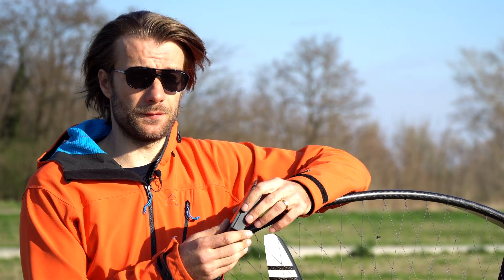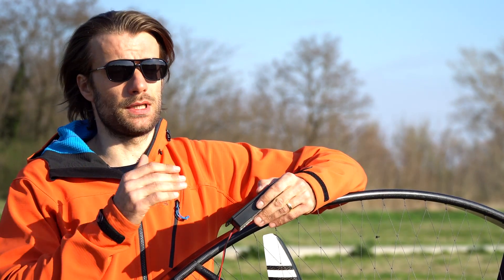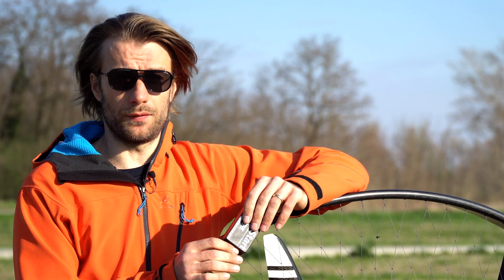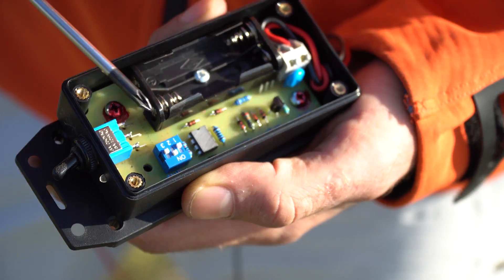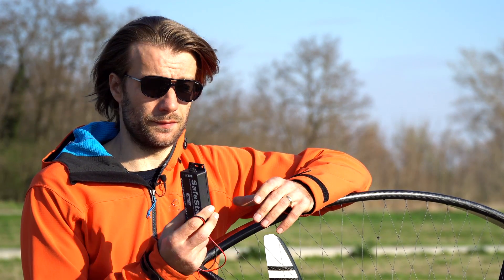The Safestar was fully functional with every engine we have tested so far. The only engine-specific setting is the RPM threshold, which you can set to determine at what RPM the Safestar shall be activated. For engines without a clutch, I recommend 2700. For engines with a clutch and flash starter, I would recommend 3200. There's a small switch inside — if you remove the cover, you have access to it. Otherwise the Safestar is zero maintenance; you replace the batteries every year and that's it. You can order the Safestar through any Scout dealer or with Scout headquarters. If it saves two fingers, it was perfectly worth it.